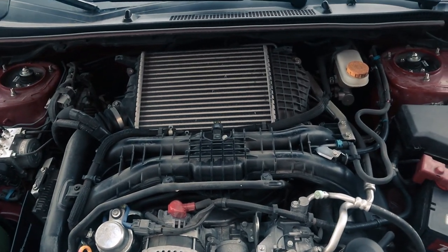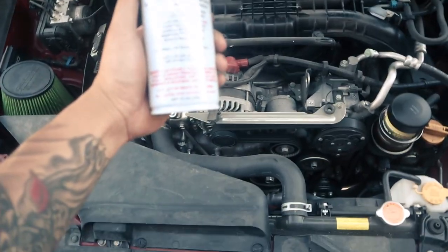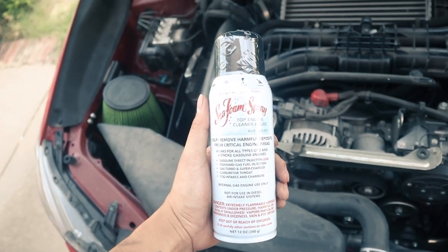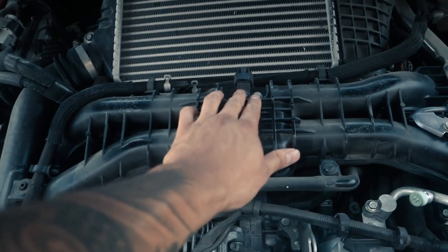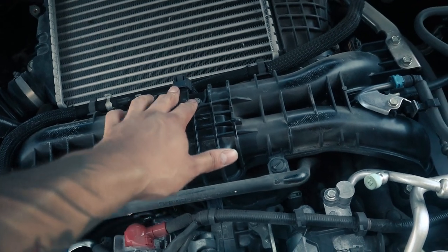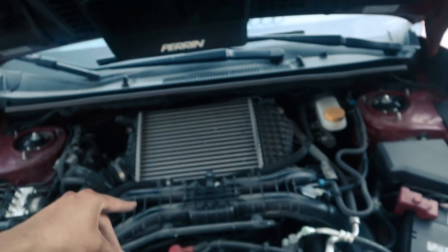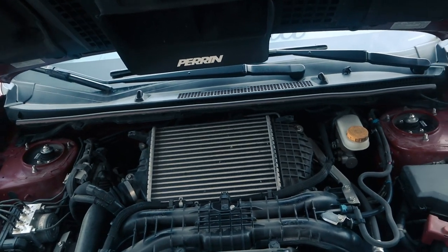Now, when you want to clean the carbon build-up on these direct injected engines, I'm going with this right here — this is the Sea Foam Top Cleaner and Lube. The point of entry is going to be right here on the mass airflow sensor. Go ahead and pop that off — I think it's a 10mm. I'm going to have someone hop in the car, idle it, and then I just spray it in there and hopefully she's clean.